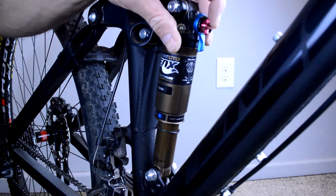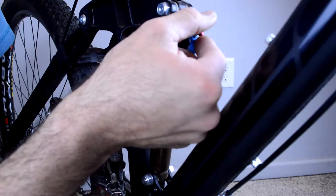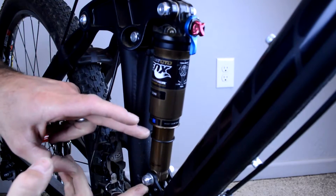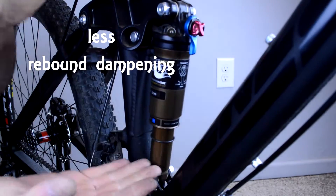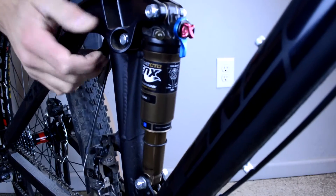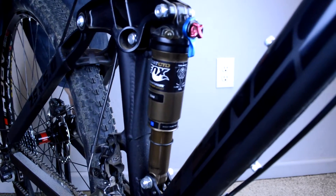The next thing we're going to look at is the rebound — that red knob. On a lot of bikes, even on RockShox forks, it's often a red anodized knob, and it should even say on there which direction is more rebound or less, with a plus or minus. The positive means more rebound control, meaning once the shock is compressed it will return to its full height much slower. Turned toward the negative, you're removing the rebound control and it's going to act more like a spring, compressing and rebounding very quickly. On RockShox it's intuitive — one direction has a tortoise and the other a hare, so you know faster versus slower.